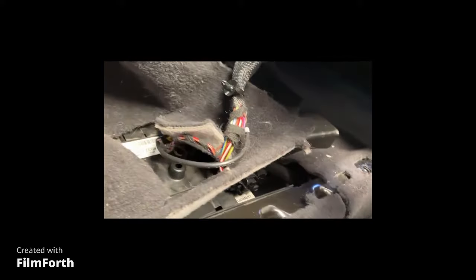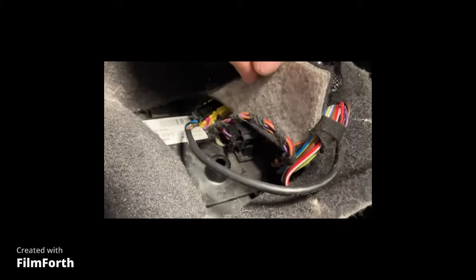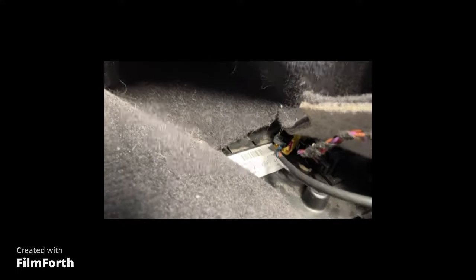When you lift the seat back, you've got some wires here. I would just recommend don't unplug the wire with the yellow connector — that's this one. This yellow one controls the airbag, so just do your best to work around that.